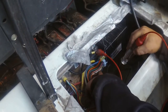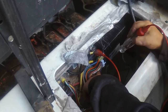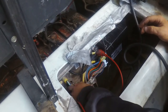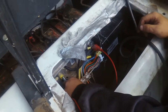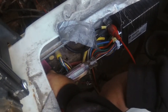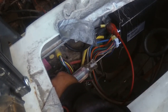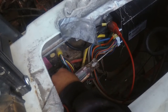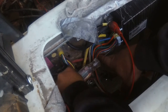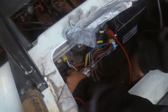We found that this yellow wire and white wire here — that's our positive power, our positive feed out of the controller. Once I went in and stuck my probe inside the pin, we found we've got no positive power whatsoever. That's not going to allow the golf cart to run. The white wire is the same — it should give a lower voltage reading since it's just a transfer wire, but probing it we again have no positive feed.